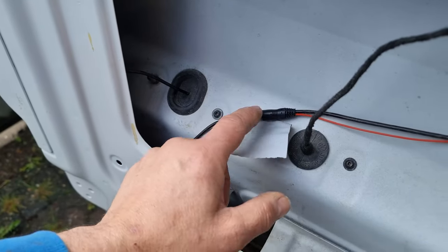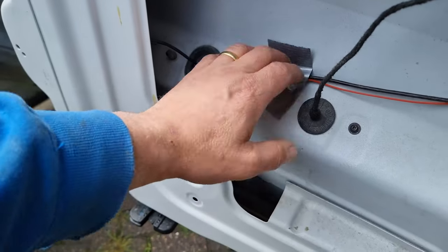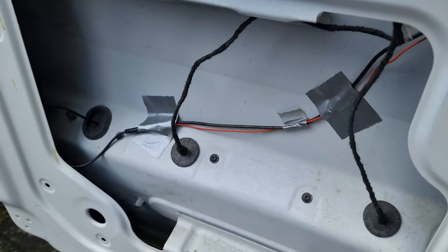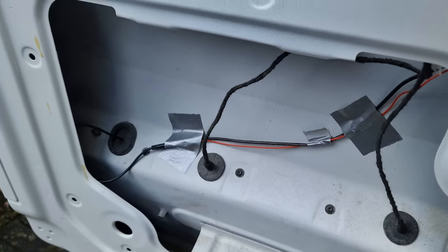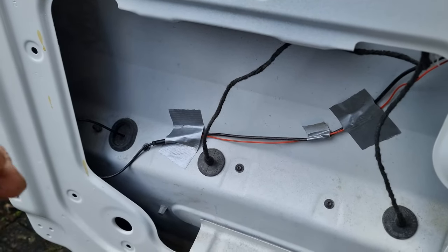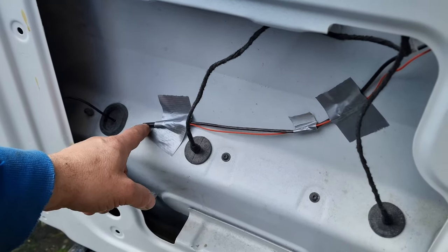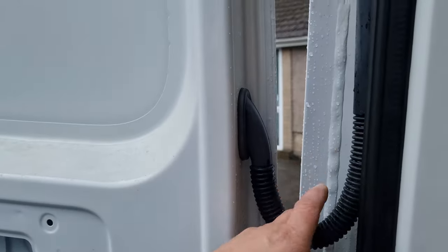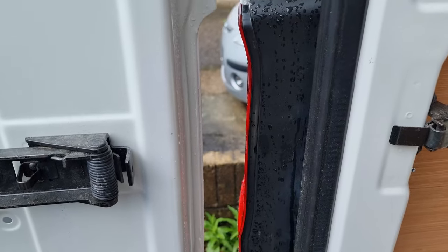At the back of the door you've got these wires coming in - the two main ones are the number plate lights, these are the original loom of the door, and this is where our camera wire is coming in through the rubber grommet, which is standard on all the vans we've had. I believe there's an option to have a camera down there. I just poked a little hole in it, pushed the wire through - it's nice and tight so it's waterproof. This cable comes up, this is the plug for the camera and this is the extension cord. The red cable goes to the rear reversing lights and puts on a display showing distance on screen. There is a fault though - when I put it in reverse it freezes. I'm not sure if it's the system not being compatible with the van or a problem with the camera, but we've complained about it and they're going to refund us and we're going to get another one.